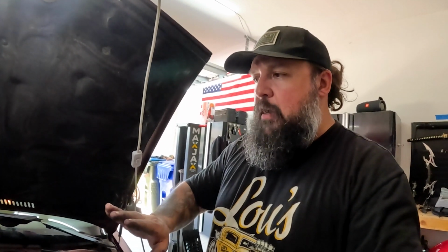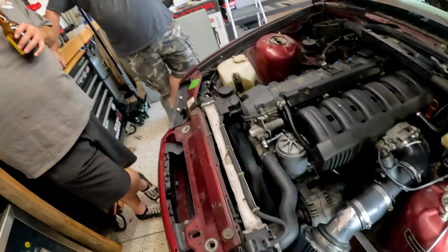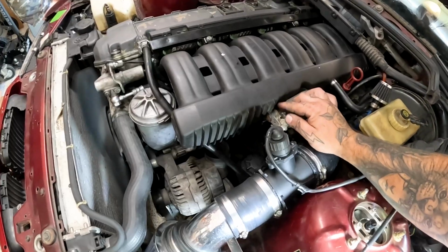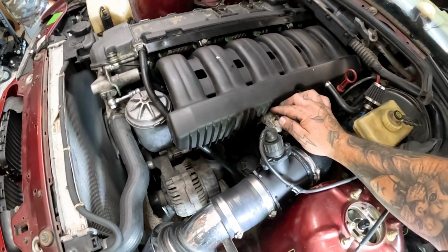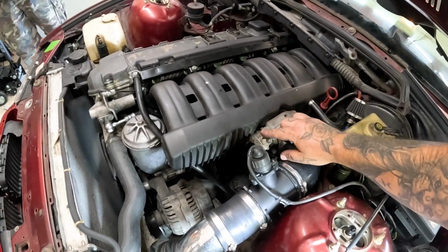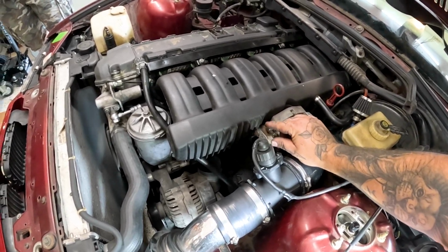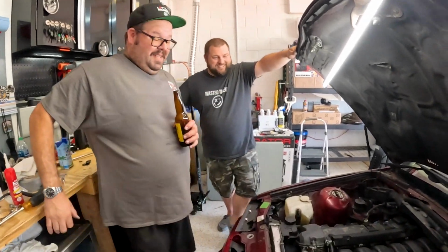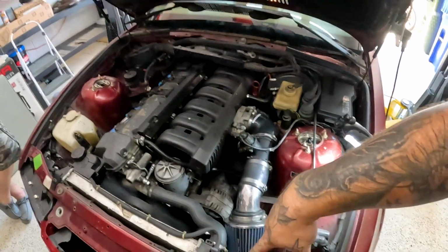All right, we disconnected the battery, cranked right up. No foot on gas, no foot on throttle, running. Was it the clutch for the AC compressor kicking on? So it's not dying whenever you rev it up now. I think that's it. A win to me. All right, so we're gonna shut it off. We're gonna get that back together and then take it for a drive.